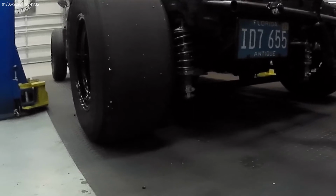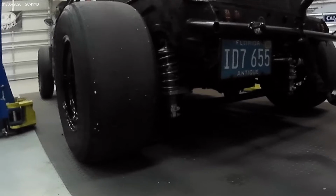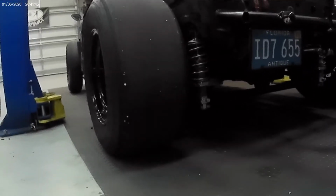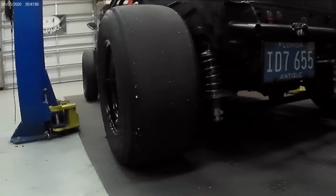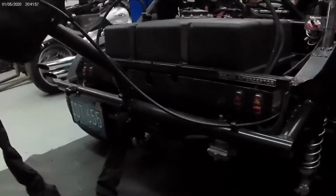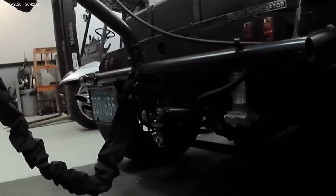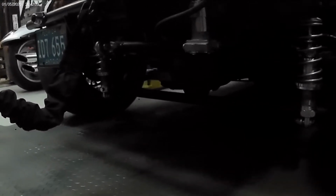It is almost exactly the same width as the Corvette IRS was, but I switched it over to that. The car's running a Turbo 400 now, so I had to make a custom transmission crossmember and mount. Also, in the back, to locate the car, because of the way these are set up, with a parallel 4-link it's hard to even get enough length to do a diagonal link bar. So this one ended up getting a wishbone put on it and some Viking Crusaders.